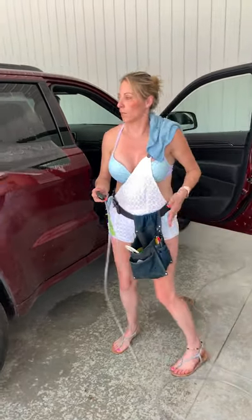We were only going to do one video, but we brought these pre-cut kits with us. Off a computer cut, it doesn't always fit perfectly. What happened on our driver's side window is the edge was way off. Some tinters might say the piece is ruined, but I try to save the piece if there's nothing wrong with it. I trim off the top edge, give it a smack, and it scoots down. We saved the passenger window to show you how to fix that issue if you're out on a mobile job and don't want to waste your film.